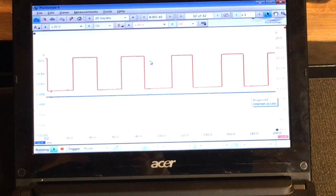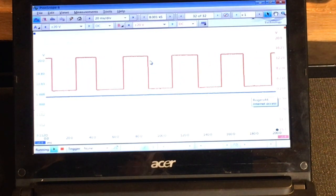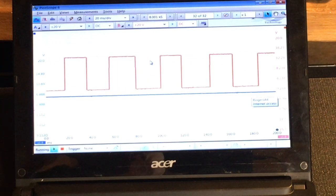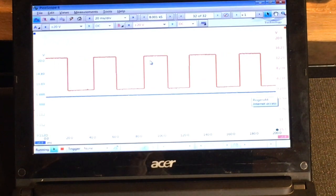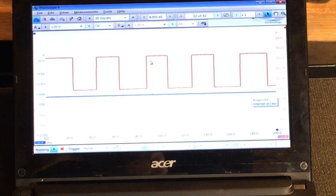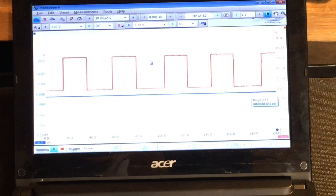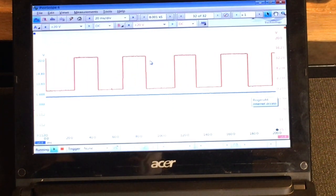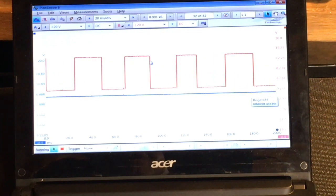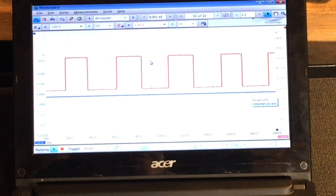I wasn't expecting this from the theory of operation description in the manual. I wasn't expecting this at all. It actually appears to operate quite differently from at least the impression I was under. Perhaps I was the only one under that impression, but yeah. So the ECU demand line, the ground side switching, only seems to happen so long as there's a differential between the request and the actual output. Once the alternator output matches that request, it goes back to the high, which does kind of make some sense. At least I think it makes some sense.